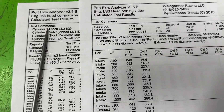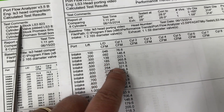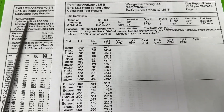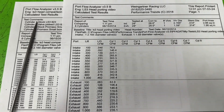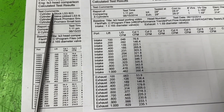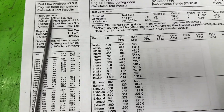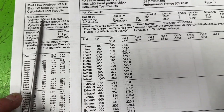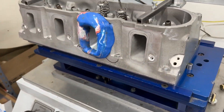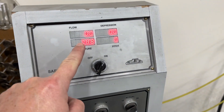Some of you have seen others go 350 - this isn't a bad head; it's pretty good flow for what it is. The low-lift flow is really, really good. Some heads I've had go 370 but with a 50-degree valve job, which is a different thing. Remember all this is basic work I showed you in the video - it's not super tough to do. It takes some time and patience, but it's doable. These numbers are definitely doable for average people, as long as you get the valve job done right. Now let me show you something on the flow bench - I have it set at 600 valve lift and I'm going to slowly open the valve.